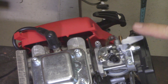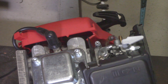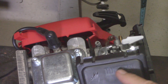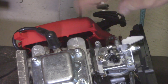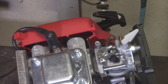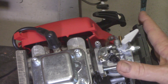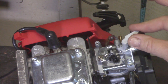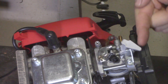This is your choke lever on the carburetor. If you ever forget, you can look on the air filter — it shows the open position, which is the running position, and the starting position. Looking down at it: turning it counterclockwise, or pulling the back end out toward the right side of the bike, closes the throat in the carburetor and chokes it, pulling additional gas in for starting. Then as the bike warms up, turn it clockwise to the running position.